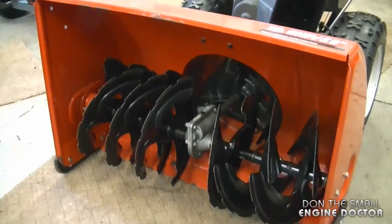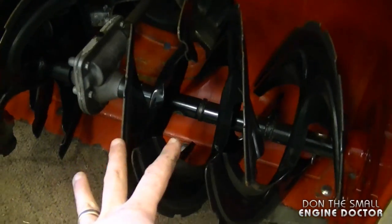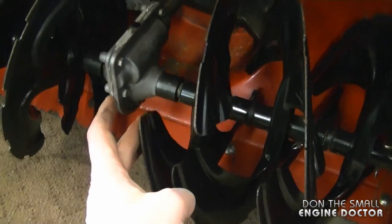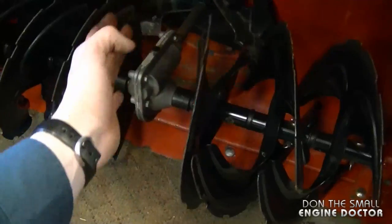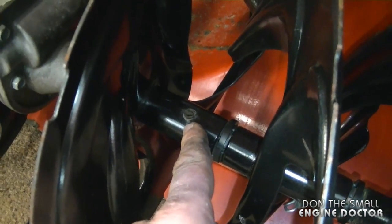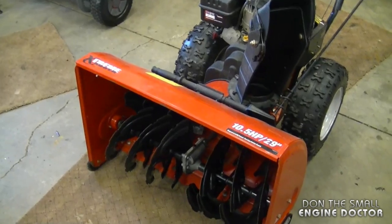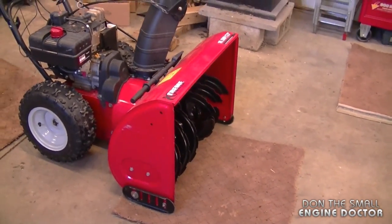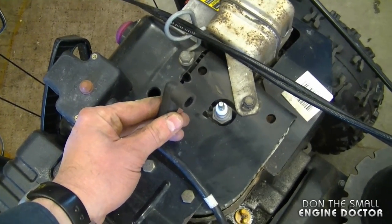In my next question, a viewer asked why one of the augers on his snow blower is just turning around the shaft. The simple answer is you've probably broken the shear pin. As you can see here, I've taken out the pin on one auger and it just turns freely around the shaft, whereas the augers with their pins in do not turn freely. If you see this, just check the shear pin — if it's broken, put in a new one. To replace it, line up the hole on the auger to the hole on the shaft, insert the pin, and make sure to put the clip or nut at the other end to hold it on. Symptoms of a broken shear pin include the blower not moving snow like it used to. For safety, disconnect your spark plug cap to prevent the engine from turning over when you move the augers or impeller.